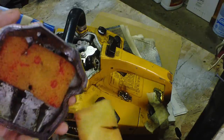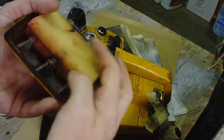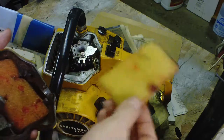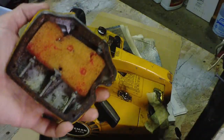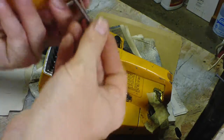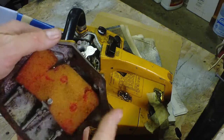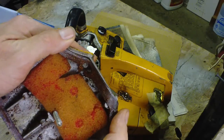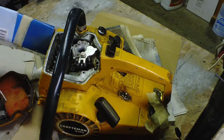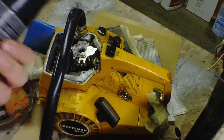Here's the tip: the foam was about a half inch thick but I had it twice that thick and it wouldn't run — it was choking it. So I cut it in half lengthwise with my scissors, tested it today, and it seemed to work fine. You just have to poke a hole in it for your screw and then cut a little slit for the choke linkage.